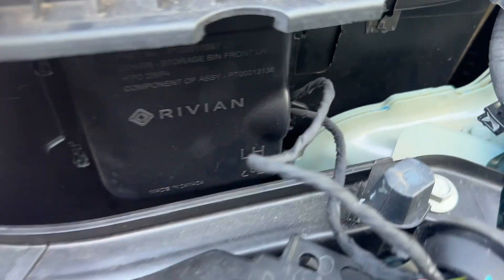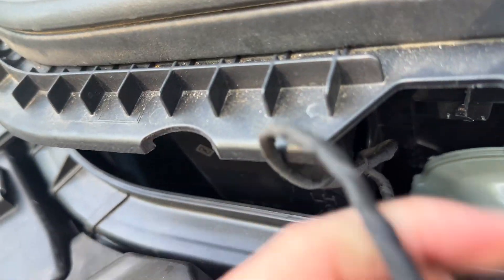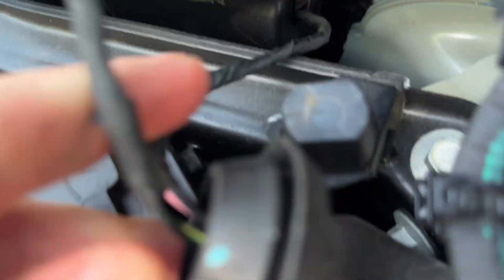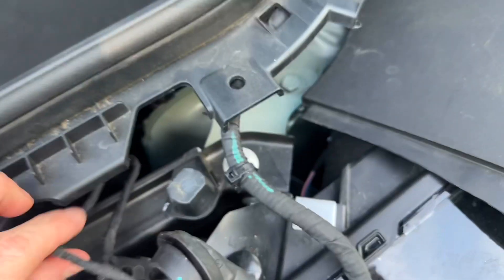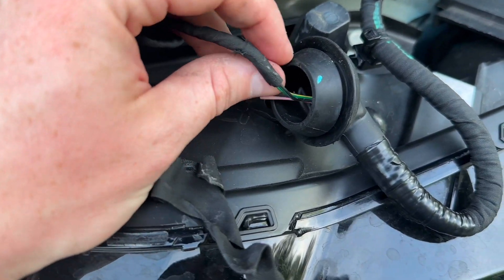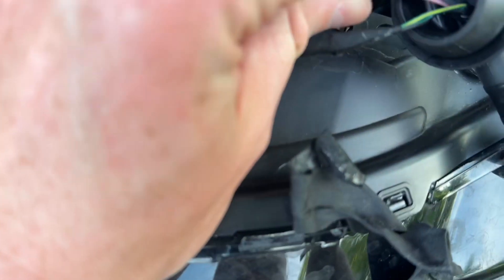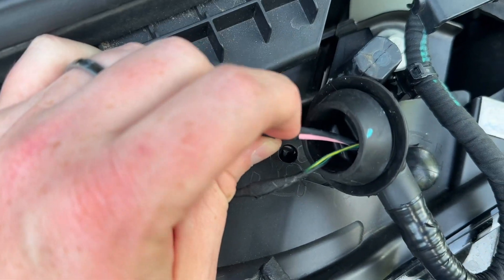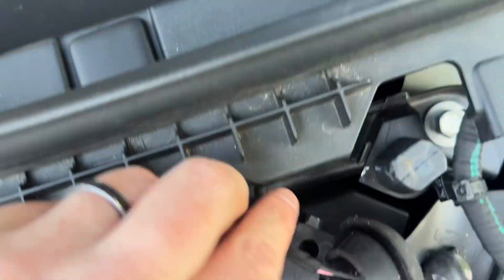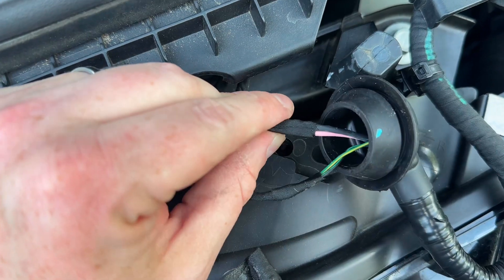Now, you don't actually have to take the whole bucket out. You can actually remove this gasket here, and then unraveling some tape, you'll see that there are two sets of wires coming from the harness. The green and black actually goes to the emergency light. If there is a 12-volt already, this black and red goes to the 12-volt — so this is the one we're going to tap. If you don't have a 12-volt, this wire may still exist, because I don't think they would recreate the whole harness. But I could be wrong.